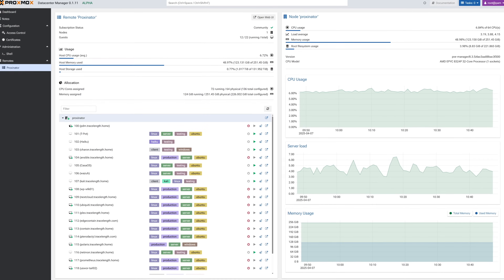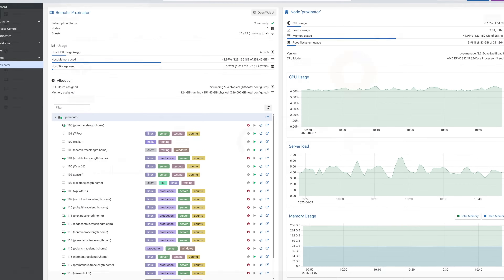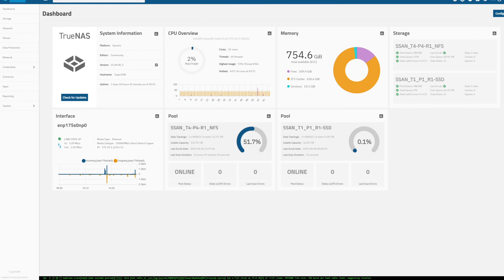You're probably asking why I'm only connecting a single 25 gigabit uplink to the rest of my network. The simple answer is that's really more than I need — everything downstream from the Pro Agg is 1 gig, with the exception of my 2 gig fiber internet connection, and there's no need for dual uplinks since both switches are in the same rack on the same UPS. The real need for 100 gig is between my Proxmox host, which runs all my VM workloads, and my primary storage — that's where the full benefit of the throughput will be felt.